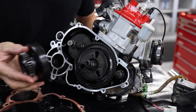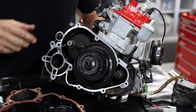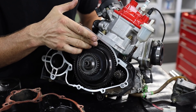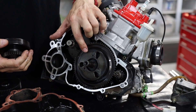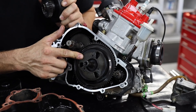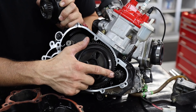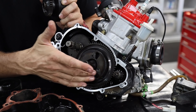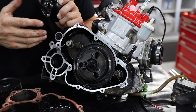To reinstall the gears, simply slide your clutch drum back over your crankshaft. This is the crankshaft and this is your starter gear on the DD2. These are your Rotax clutch shoes — they're a bit thicker on the DD2 as opposed to the Senior Max engine, so they're not interchangeable even though they look very similar. And there's your Bendix gear. There are some similar parts here that are crossovers from both Senior Max and DD2.